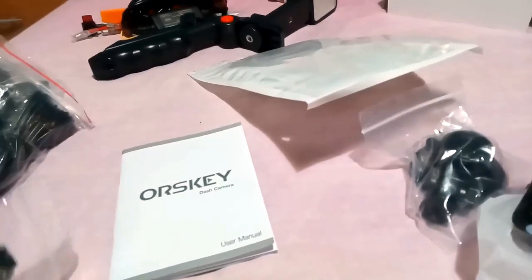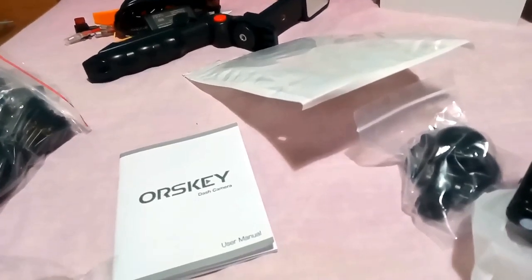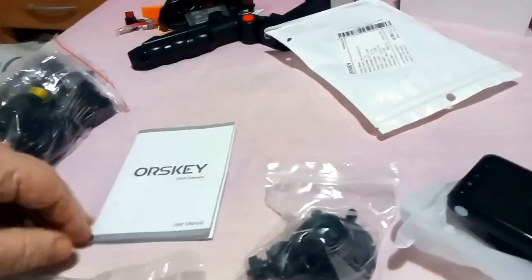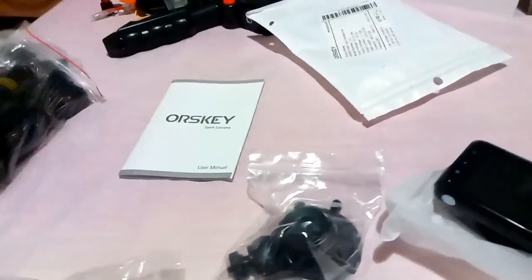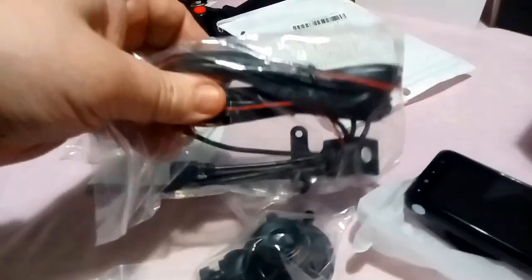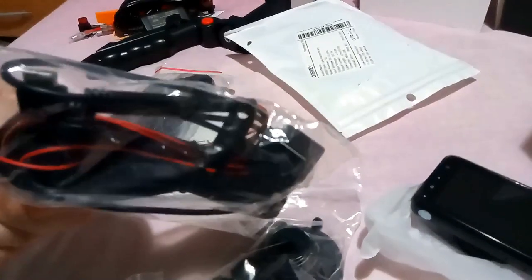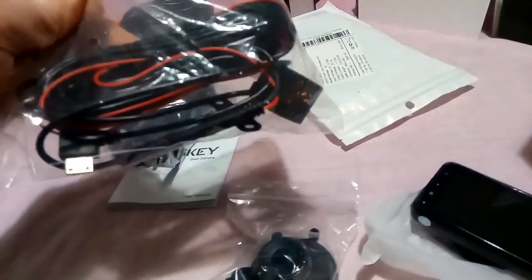And that's the sucker bracket. They say it's quite important to make sure that you wire it up properly. But it's a very quick installation if you just do it simply. One of the biggest problems is going to be finding a location for the rear camera. Because theoretically it's just a case of sticking it on the back windscreen. But if you want to use it for reversing and things, they suggest you have it outside for a nice clear image.